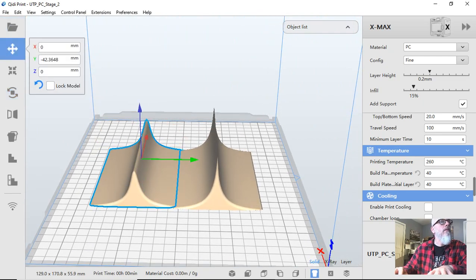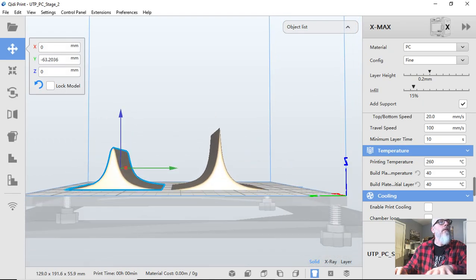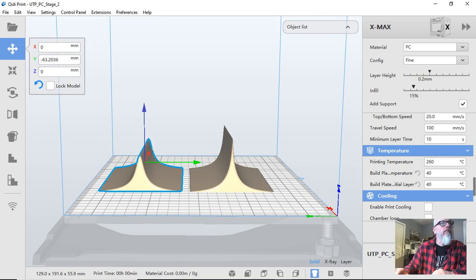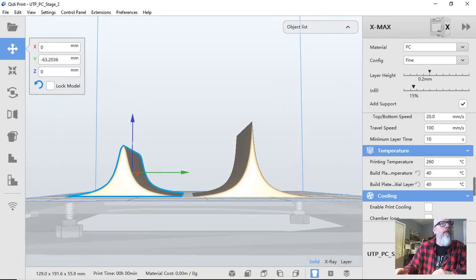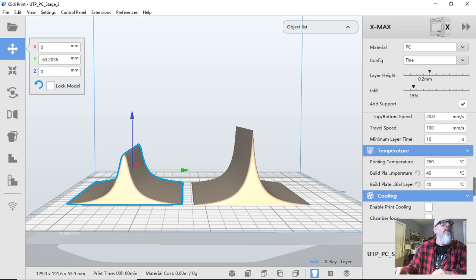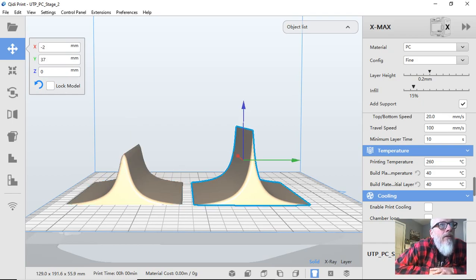Let me separate these two so you can see them a little better. From the side, what we've got here is a difference in height from where the wedge actually blocks airflow to create that velocity. You can see with the smaller stage 2 here compared to the stage 1. The stage 1 is just for extreme velocity, low RPM torque, below 3000 RPM. The stage 2 is a smaller wedge that's going to allow more airflow between the VRP and the plate to get to the runners, increasing velocity and CFM from 3000 to 5000 RPM.